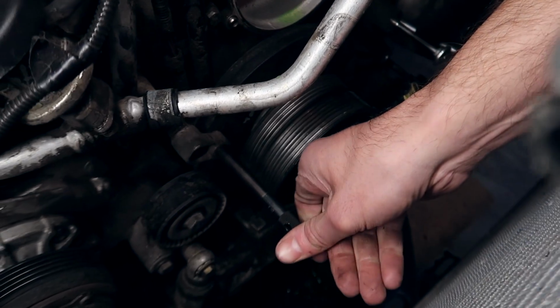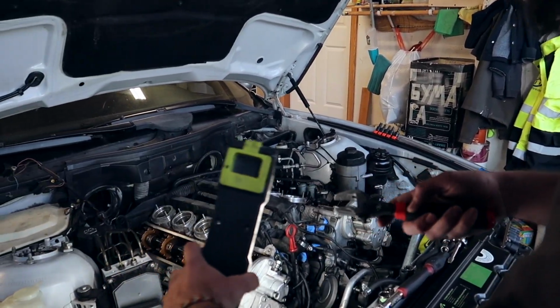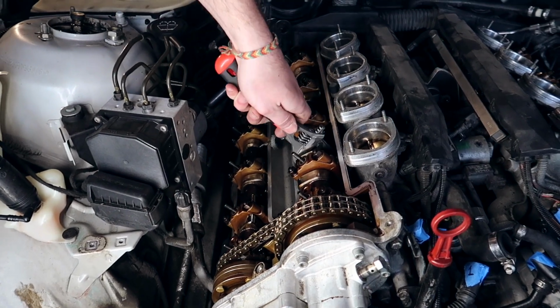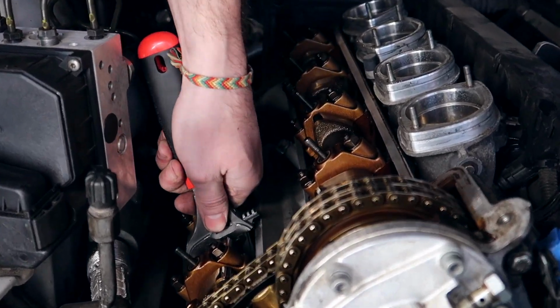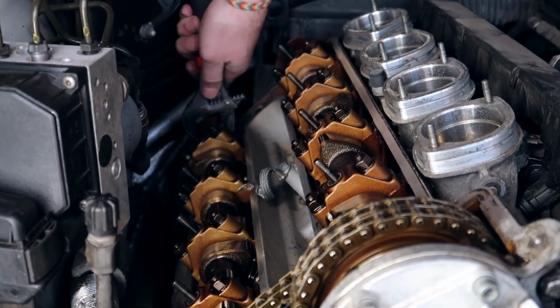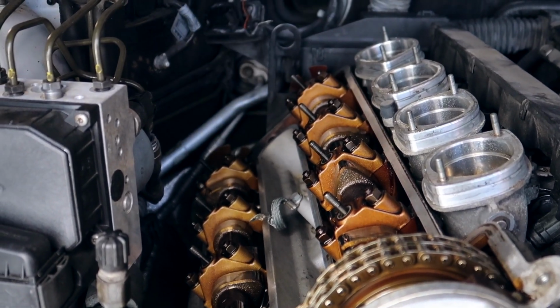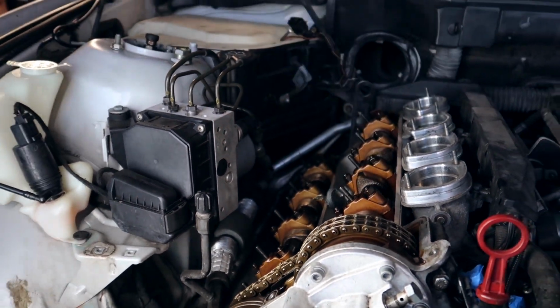You put this little tool in there, take a wrench. I have an adjustable one just because I don't have a size this big. You take your camshafts and you retard them. You rotate these camshafts as far back against the rotation of what they naturally spin in, right? So once they're locked and they go as far back as they can, you leave it at that, and that's what BMW claims for us to do. You do the same thing on that side.